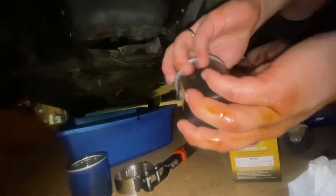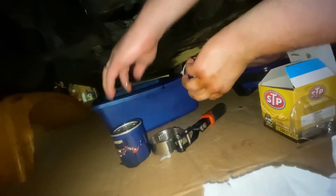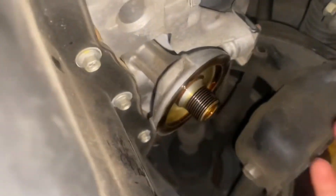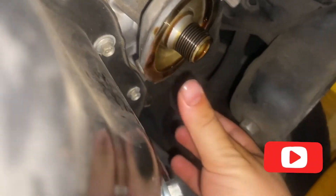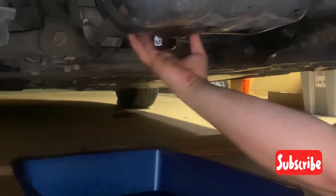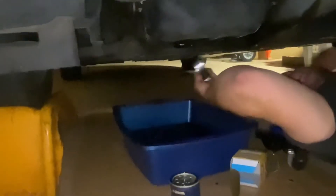Grab your finger and dip it in the oil from the old filter for lubrication and apply it around the gasket of the new filter. You also want to check right where the oil filter seats — sometimes the O-ring from the old oil filter stays on. Make sure that's off. As you can see it's off, so now go ahead and put the new one on. I love to use STP — usually I buy the one guaranteed for 10,000 miles. After you install it hand tight, grab the oil filter wrench and snug it up just a bit for safety.